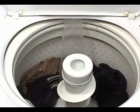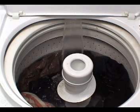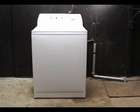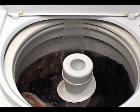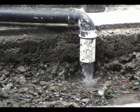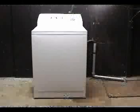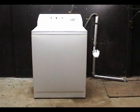Close the controls panel and install the knob. If the problem is that the washer starts taking water and when it gets to a certain level the machine keeps filling but never reaches the high level and you don't see any water leaking on the floor, you need to check the drain pipe. When the water level reaches the height of the drain pipe, water will start siphoning out. If the amount of water going out equals the amount coming in, the washer will never fill to the high level. The solution is simple: make the drain pipe and the drain hose higher than the top panel of the washer and you won't have this problem again.